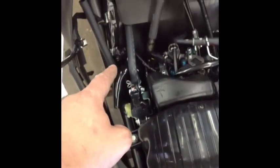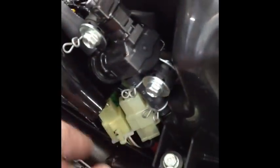So what we're going to do is just install the wiring harness now. It recommends to install it from back here, forward, over, up this side, and hit all the wiring connections. You'll find most of them will be right here. Remove this sleeve, pull this up. There'll be a lot of them here that you'll just unclip and reclip with all these. Your grounding terminal will go into this right down here where all these green wires go. You'll just unscrew that, put your spade connector in there, and then bolt it back down. So let's put this together and see how it goes.